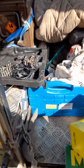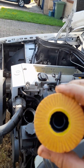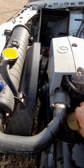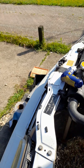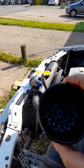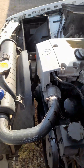Let's see — this is where they've given you the wrong filter. Oh no, that looks like the right one. You've got to make sure you put that end in first. Don't put the sealed end in — you want to push the open end in there. You'll feel the center of it. Just take your time, wiggle it around, and it'll slot on like that. Then the cap — it's got a little fitting inside — will fit on the top of the existing filter and screw on.